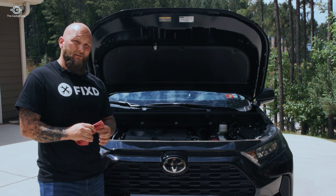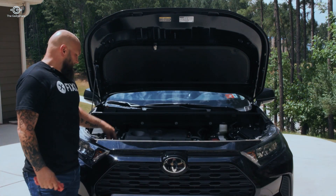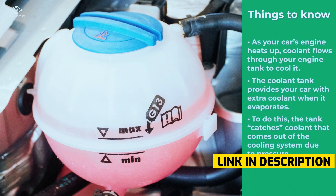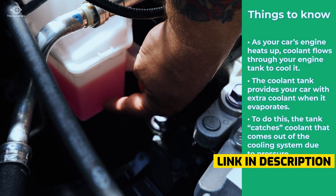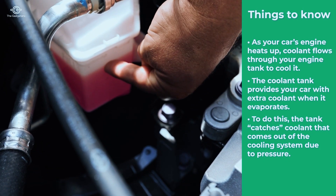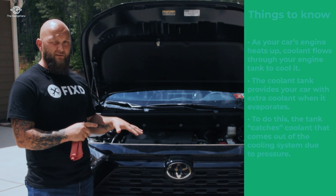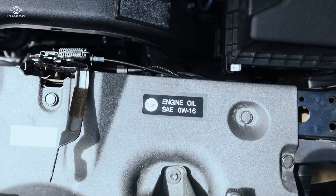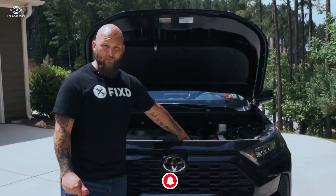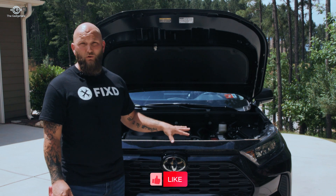Don't overfill and don't underfill — when topping off oil, do it a little bit at a time. The second thing to check is coolant level. In the engine bay you'll see your coolant reservoir, labeled with minimum and maximum marks. On this car it's right in the middle — check it with the vehicle off. Make sure the coolant you're getting is made for your vehicle. A lot of times there's a sticker in the engine bay telling you what oil weight to use — be sure to use whatever is specified.